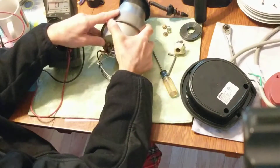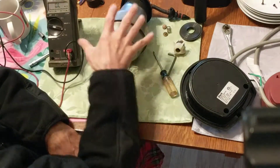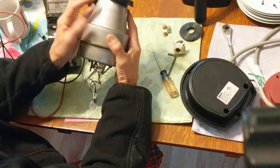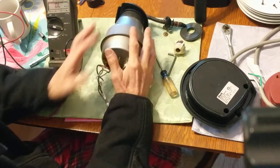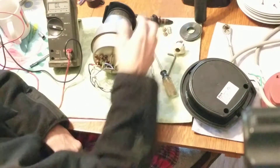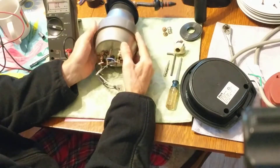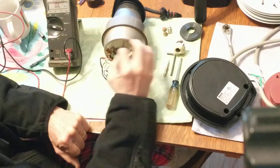If the seal were to fail, it's certainly not unusual to get water in there, and once you get water in there it's possible to create a short. I'm going to continue to experiment — add water and see if I can pick up shorts. This was tripping the GFCI breaker outdoors, indicating a path to ground. When I disassembled it, everything was very wet. The fiberglass-type spun insulation between the layers — I have it out on my line drying right now. It was all wet, a very bad sign. The device is over 30 years old.